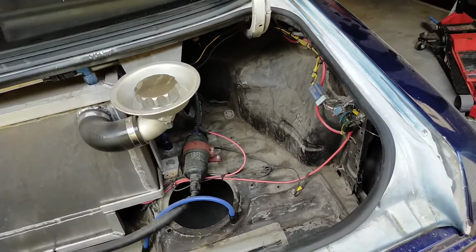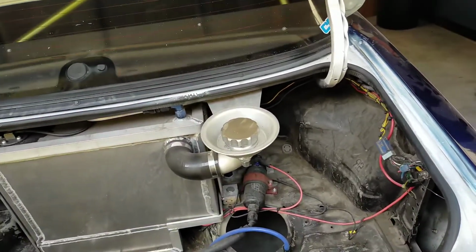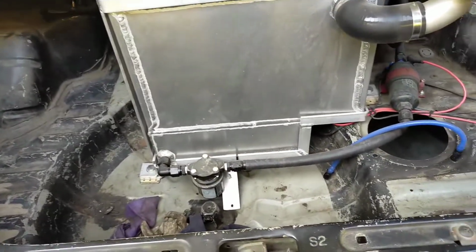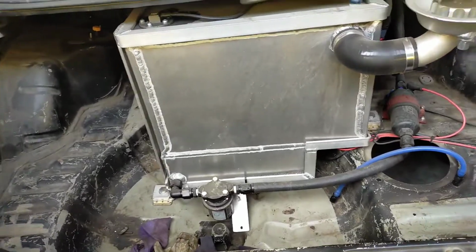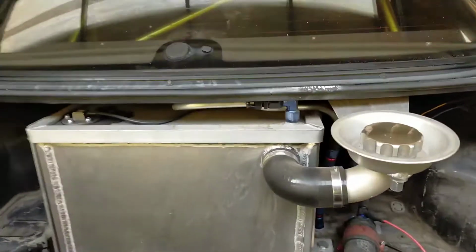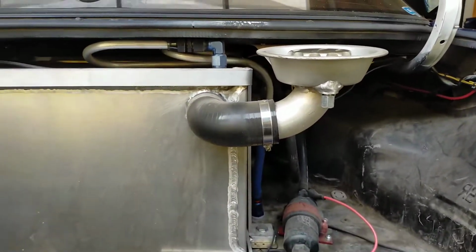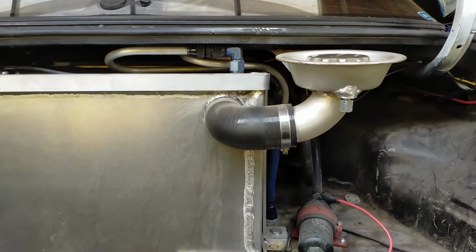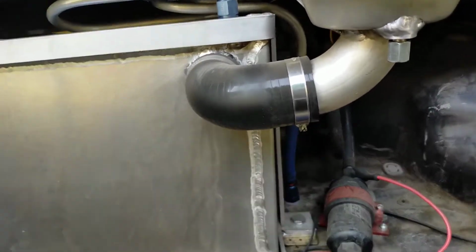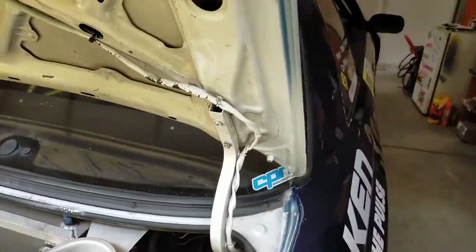And then run 2 of those fuel pumps up to the engine, with the Carter's pump feeding that. Obviously down the bottom there is a surge tank itself, but I want to pressurize it just to make it even better. On the top, it's actually got a pig's tail there where it drops out the bottom to the breather underneath the car, so with an anti-rollover valve. Yeah, and the filling neck and all that jazz. But that's about it at the moment.